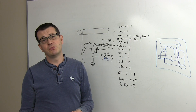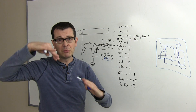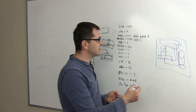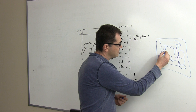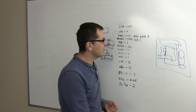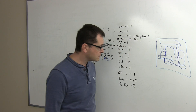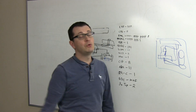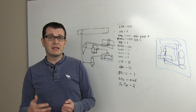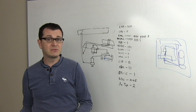If you'd like to go a step further, you might look at angle adapters so the tubes are not as loopy and are a little more straight. Then you try to do more of a 3D projection of how the parts are located in your case. You might say, okay, maybe from the CPU a 45-degree adapter works here, and another 45-degree adapter there so the line is nicer; from the GPU bottom a 90-degree adapter makes sense so we're facing toward the pump and reservoir combo. With a little practice you figure it out pretty quickly. If you're having trouble, it's advisable to look inside your case — that really helps.